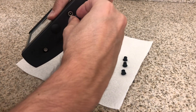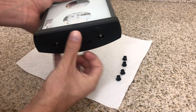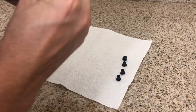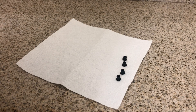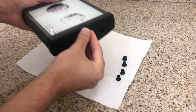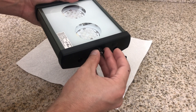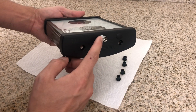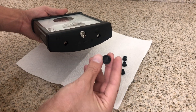Once you get those out, you're going to have to remove the power button itself — and again, it's not a button. This is where you really see the mechanism. Getting it out is just like the screw covers: try to put your nail under it and slightly pull it out. But you don't want to pull it out completely all at once. As it releases, you want to do a loosening motion as if it were a screw. You'll notice a spring on the inside, and we don't want to over-pull the spring as that will cause the button to not work down the road.